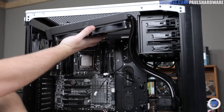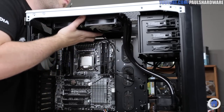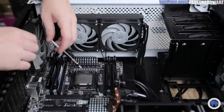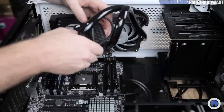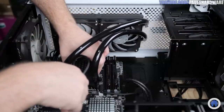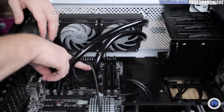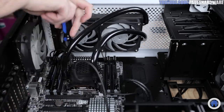I'll begin with the radiator on top of the case. I've already swapped in my Gentle Typhoon fans, I've set it to push air up through the radiator, and I will just hold the assembly from beneath and line up the 8 screws on top. After getting a few in, the radiator can support itself, and then I can finish off the rest. In a lot of cases, I would need to worry about a back plate on the motherboard for installing the CPU water block and pump, but thankfully with Intel's enthusiast platform, there is one built-in. I'll be using the same principles from the stock heat sink fan installation: a small pea-sized blob of thermal paste in the middle, lower the block to spread the thermal paste evenly, start by getting one corner screw threaded, then move to the opposite corner, then tighten each one a few turns at a time in rotation.